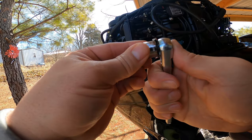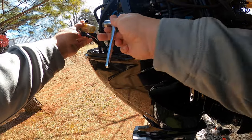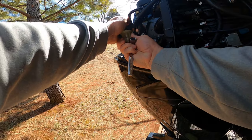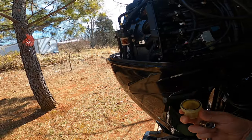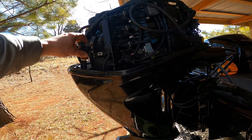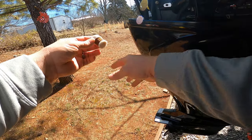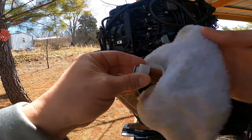You're going to need a 14 millimeter socket and a ratchet. This rubber grommet mounts up here — it's going to slide right out, it's not very hard to get out at all. Hold on to the top and then gently break the canister loose and unscrew it. Dump that gas out of there — I put it into my oil drain pan, not on the ground. Pull that fuel filter off — as you can see, it's pretty dark and dingy.